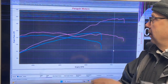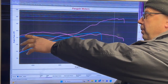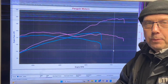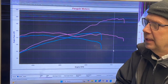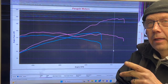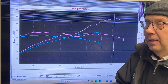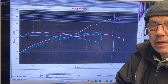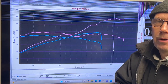Just for comparison, I put the same carb up on my standard engine, and we're only measuring from 3,500 RPM onwards — but didn't it go? Clearly it got to about 5,500 and took off. I spoke to Ike at the time and he went, 'that's a bit low' — he was expecting more. As it turns out, the exhaust manifold I'm using isn't the one he thought I had. So if we'd had the two-into-one as opposed to four-into-one, he reckons I'd have found even more power. But at this point he said to me: play with the cam timing. So we did.